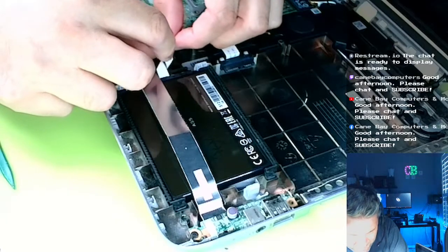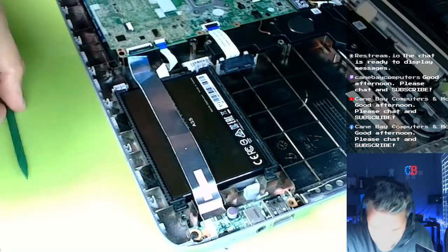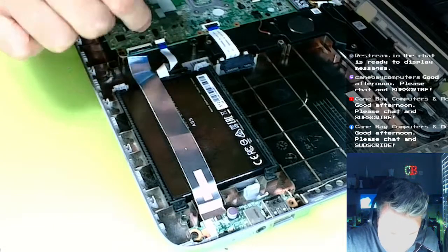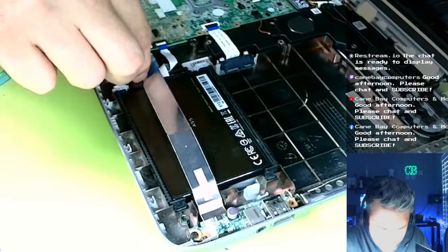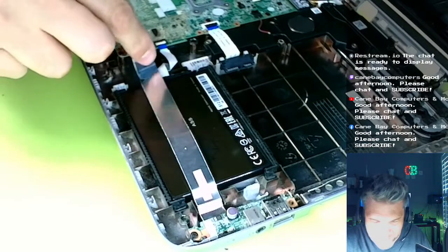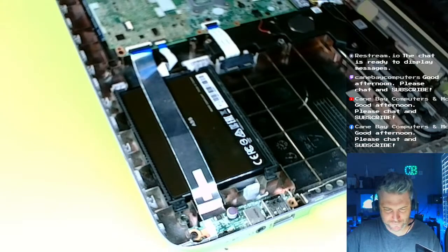And we're going to plug it back up on the FPC connector. It's just giving me a hard time. Why isn't this going in? Oh, there we go. Looks good. I know you probably can't see this detail, but on these FPC connectors, there are little black lines written on the pull tabs. When you flip the latch, it should bump right up against that black line. That way you know the FPC connector is in. FPC stands for Flexible Printed Circuit, because it is a printed circuit. Some people just call them a ribbon, which is fine. We're not too technical around here.